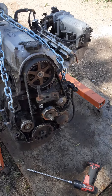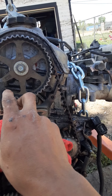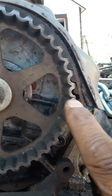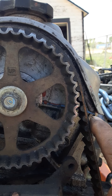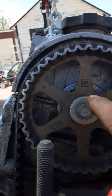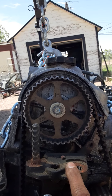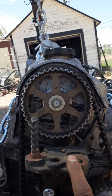I'm gonna get my timing in line. For those who do not understand timing marks, there's a line right here on your cam gear and one here on the cam gear. Those need to align with the top of the head or the bottom of the valve cover. That's when you're in the straight-up position. When you're looking at the car, the motor is tilted in the car, so that is not the true up position.